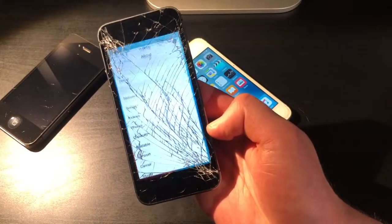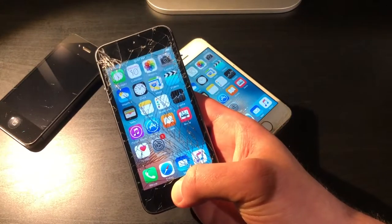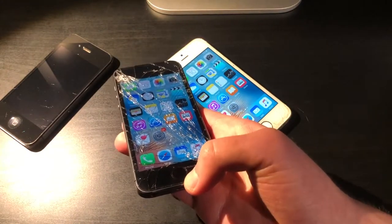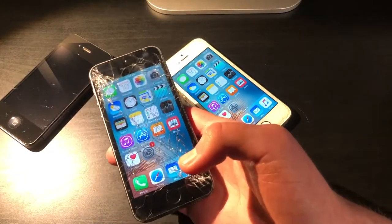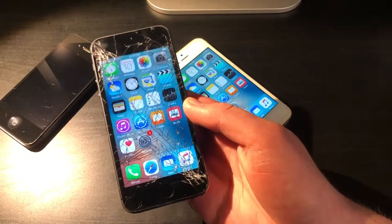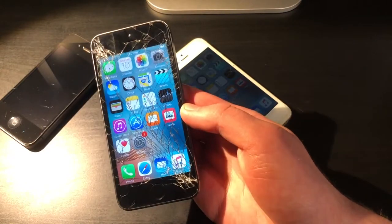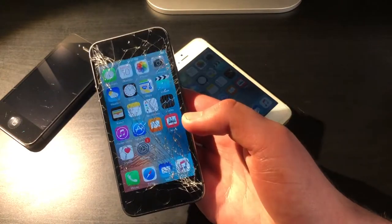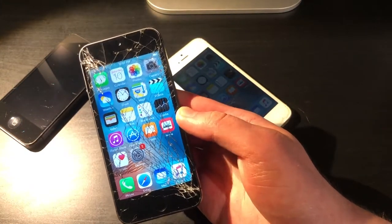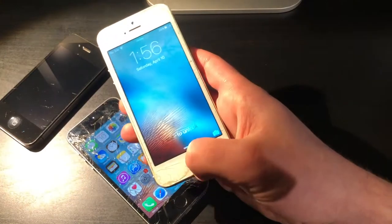But for the 5s that was in the lot, because this is on version 9.2, it seems like it could have potentially completely bypassed that problem, because ever since the setup, I haven't gotten the activation prompt, and it's still been keeping track of time properly. So it could still definitely be something wrong with the logic board, but I doubt it because it seems to be working just fine. iOS 9 is known to have problems with activation, so because this one is on an older version, it kind of makes sense that it doesn't have those problems. But iOS 9 in general can still have issues on 64-bit devices, so it could be a matter of time. After several resets and just using it around for a little while, it seems like it still works just fine. So hopefully iOS 9 remains usable on this one, while the other one just has the interesting feature of not keeping track of time properly.